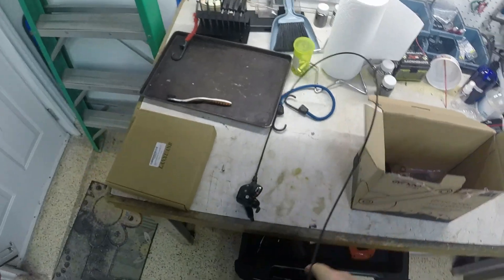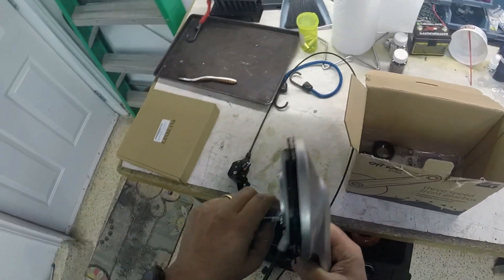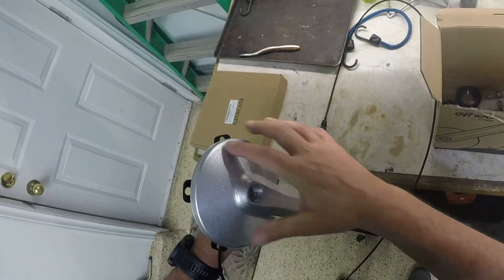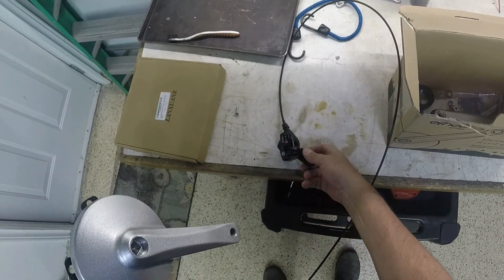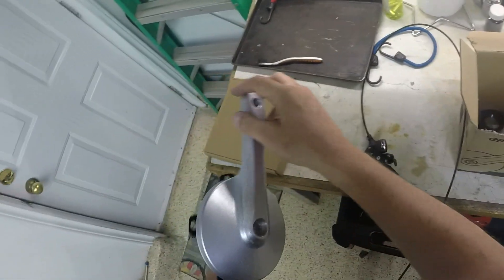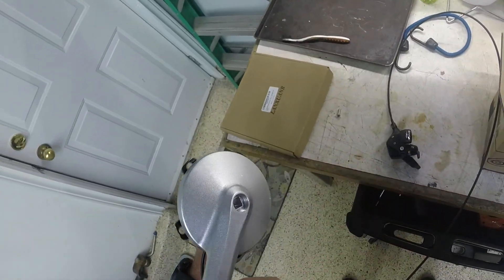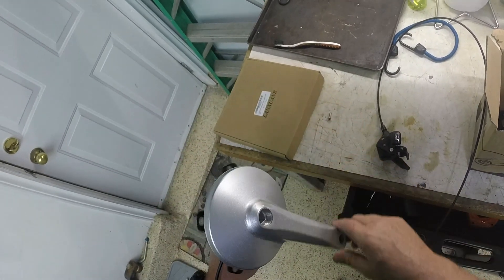Here's the transmission itself. As you can see, it's a fairly compact, very flat device. It weighs around 180 grams more than a triple chain ring with a front derailleur — so not super heavy. You can see that when we crank it around, the spider is actually moving at the same speed as the pedals — that's first gear, so the physical chain ring is low gear. In second gear, the BCD spider is now moving faster than the crank set — 1.4 times the speed — giving you the virtual chain ring for second gear. And then in high gear, it's going 1.79 times as fast — more than one and three quarters faster. So that's how it works.